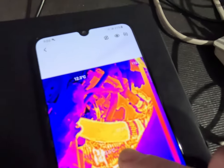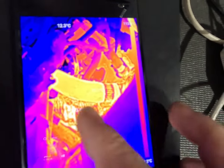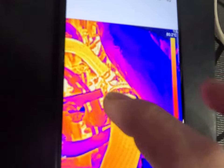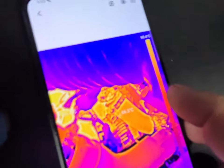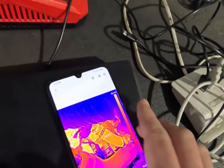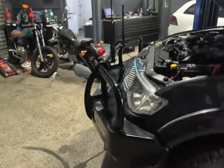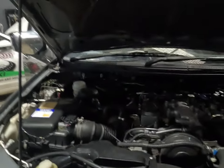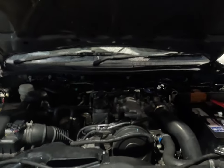Just to show you, we haven't just used the little thermal laser gun — this is with a thermal camera. As you can see, when it's at 77 degrees Celsius on the hose, it was actually reading 100 degrees on live data. And that goes across the board — 70 degrees on the inlet and the outlet, roughly 65 to 66 degrees down there. So this was reading 100 degrees when I got back from the test drive. We've definitely got at least a 20 degree difference here, so we're going to get a genuine sensor in there and see if that sorts it out.